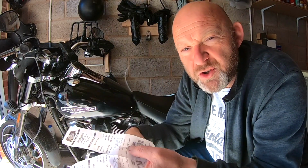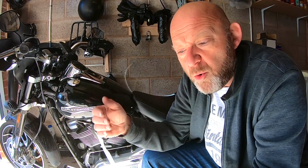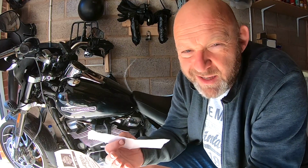It's a 17.5 amp hour battery on the Softails as well. And that 315 amps is at 0 degrees Fahrenheit, which is minus 17 degrees Celsius. Okay, so they did their test, and obviously it's at room temperature, so let's say 18 degrees Celsius, something like that, so it's substantially a lot warmer. So my battery, which they tested on their diagnostics and charging machine, was 395 CCAs, or cold cranking amperage.